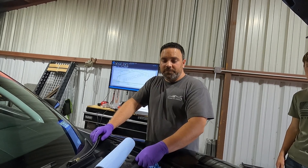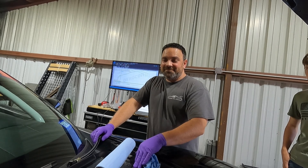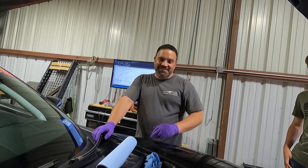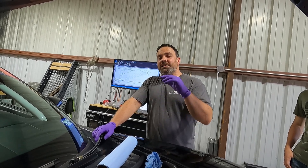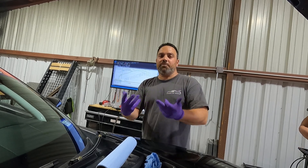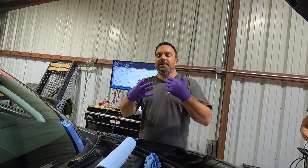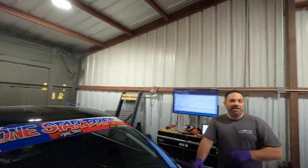Another bonus — we're running 30% more fuel, so we're going to go through it quicker and it'll run cooler. Exactly, on top of the cooler burning effects of E85. That's part of why it runs cooler, actually — because part of the cooling effect is the vaporization of the fuel. We're vaporizing more fuel into the engine, and that's actually cooling the heads and everything else. So that's part of the benefit.